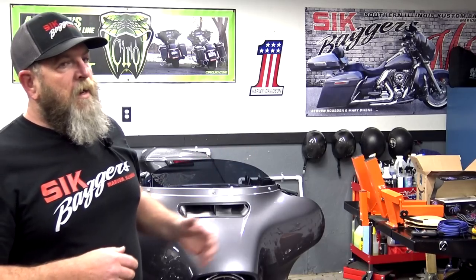There's not a whole lot of other stuff that I can really share with you on this install, because the things that I didn't really concentrate on, like the line out converter, that's going to be based on what kind of line out converter that you get and tuning the amp. Like I said in the beginning of the video, I'm not going into tuning. The biggest thing there is don't treat your gain knob like a volume knob. It's not. You turn that gain and it is going to get louder, but that's not what it's for. It's not a volume knob. You're going to cause distortion. Distortion will smoke your speakers. So just keep that in mind when you're tuning and you'll be good to go.